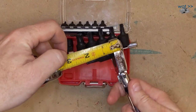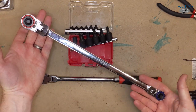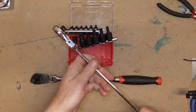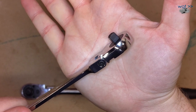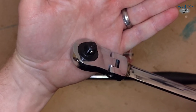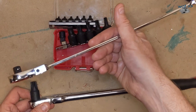You can see that — just barely. Harbor Freight has since come out with this, still in the Pittsburgh brand — pretty cheap, doesn't feel very solid. But it is the hardware of a ratcheting wrench with a quarter inch ratchet driver on one end with a flexible head, and a 3/8 inch on the other. It's even thinner, so it can get into places that are just a little bit tighter. If we'd had this, we definitely would have used it.